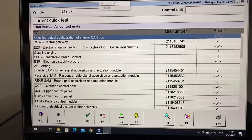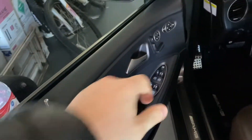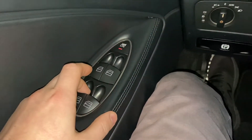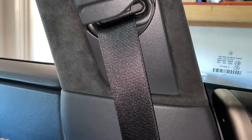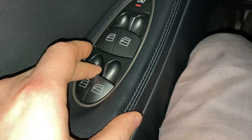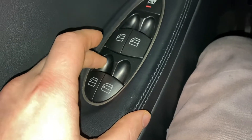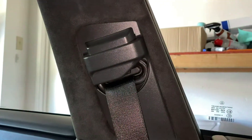I'll try to calibrate the window by going inside the car and playing with the regulators. I've already reset one window and now I'm doing the next. Basically, I put it in the first position and then wait 10 seconds, then put it down — not automatic, just the first position, don't push harder to the second. Once it's down I can push it two clicks and it should go up. Now I'll continue on the passenger side — put it up, wait for the click on the door, then wait 10 seconds.